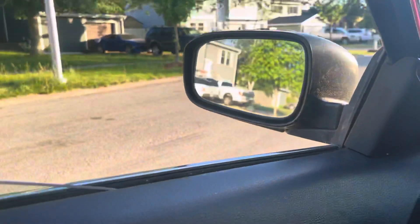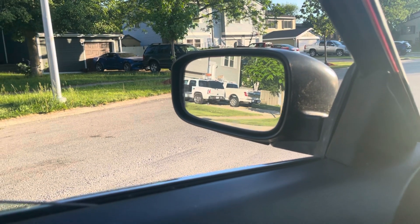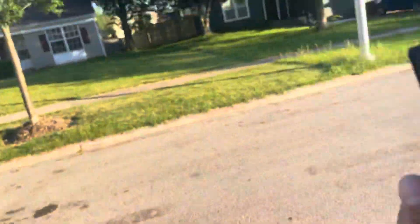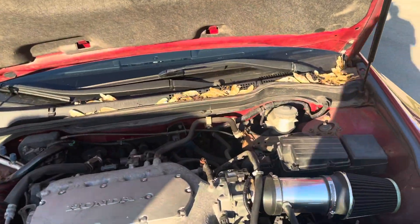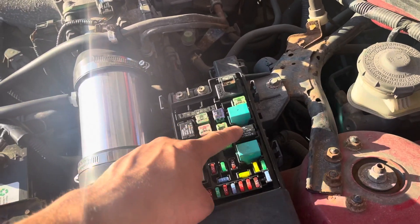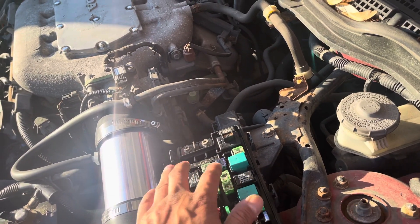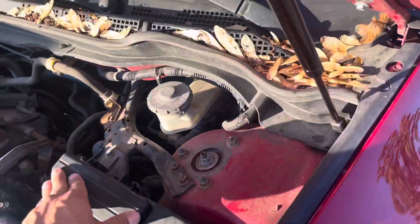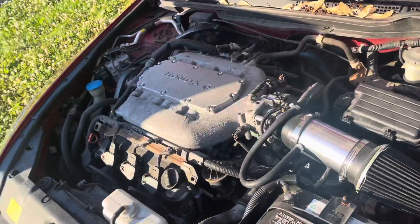Here's how I solved it. Here's where you pop the hood, and here's where the auxiliary fuse box is for the kick panel I was talking about — we'll come back to that. Pop the hood and lift. Coming over to this box in the engine bay, this will be your main AC clutch fuse — I swapped them just to test them. This is the 7.5 fuse I was talking about right there; that's the control module fuse that controls the AC timing control, AC, blower motor, and functionality of the actual compressor for the AC.